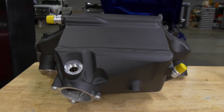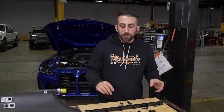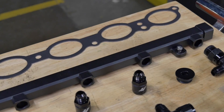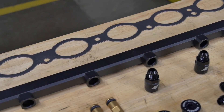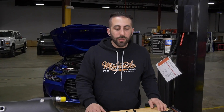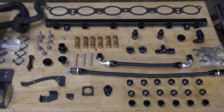With this intake manifold there were two big design constraints. One was port fuel injection — we're adding a system where you can run six port injectors to go along with your six direct injectors from the factory. We also have a solution for those who aren't running port injection, because people are going to be running this manifold at all different power levels.